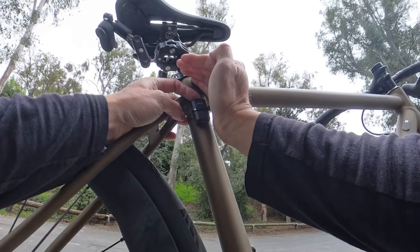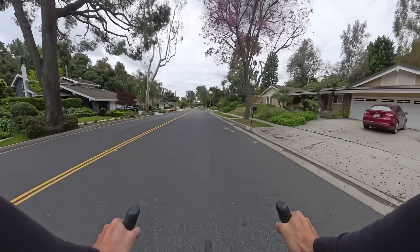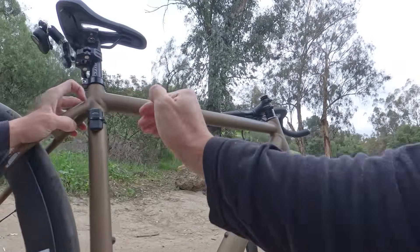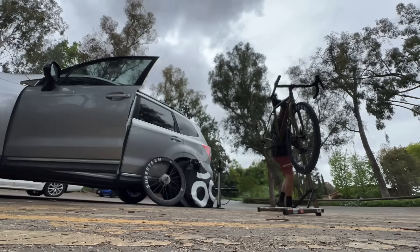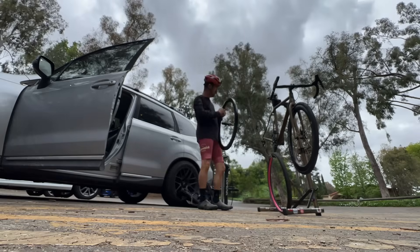The test I ran was pretty straightforward — very similar to the other vibration damping videos I've done on steel hardtail frames and carbon handlebars. I fixed an accelerometer data logger at the top of the seat tube, and then I ran four separate tests. First was a half-mile road section, slightly downhill, on the Superteam Ultra H2s with Conti GP5000 tires in 32mm width, set up with a TPU inner tube at 60 PSI. Then with the same setup I did a half-mile fire road descent to represent a really rough road, being careful to stay seated. Then I swapped the wheels for the Goosen TIFI R50 wheels right there in the parking lot, using the same bike, same tires, same inner tubes, inflated to 60 PSI.